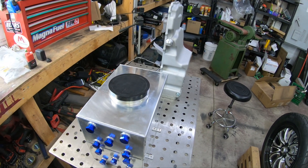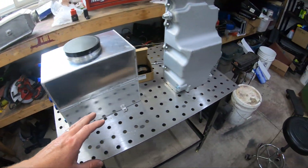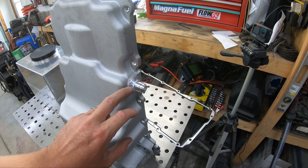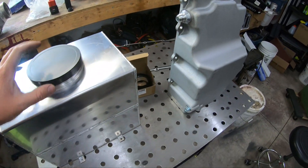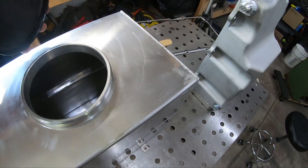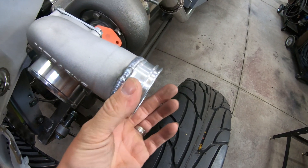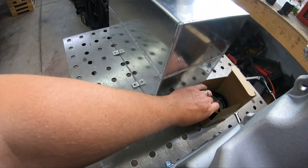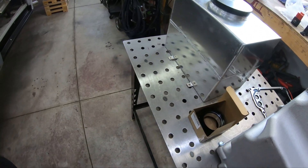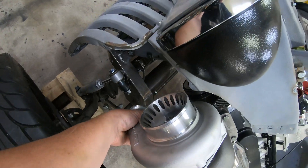For the aluminum parts, I can't weld aluminum with this TIG welder - it's not an AC-DC, so I had to farm that out. I sent it off to my buddy Brandon at Twisted Art and Fab. He welded on my bungs for the oil return. I had purchased two ice water tanks and we welded them together, so now when you look inside I just have one big tank. We also got ends welded on the turbos for this style of clamp - it's supposed to be better than a V-band, so we will find out. A lot more secure, apparently.